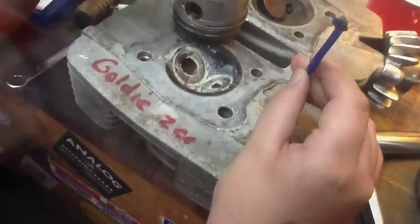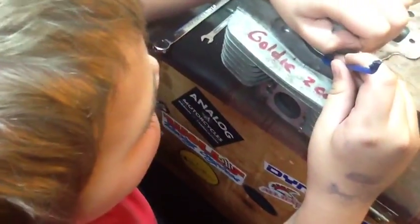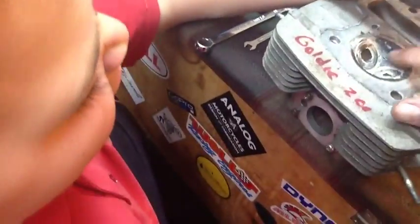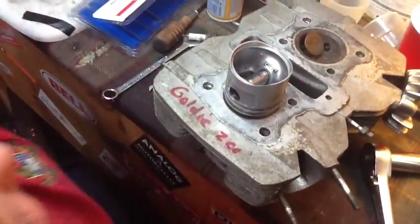And that's what we ended up with, so it measured this side of the piston - the squish. I don't know if it measured the squish or not. Maybe it did measure this part of the squish - piston to head clearance. We're at .045 and we're not supposed to be anymore.